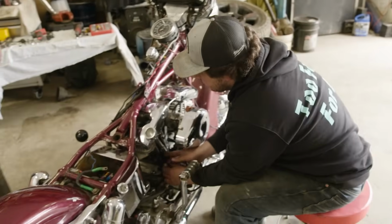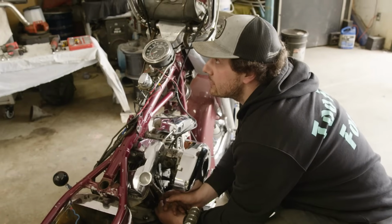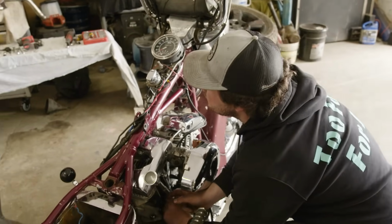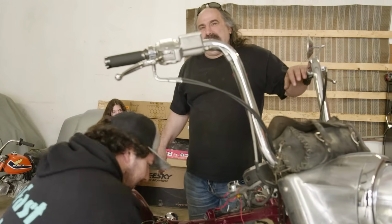Okay, guys, we got this thing all set up now. There's a perfect amount of drag on it. We won't even ask Dad for his opinion because we don't care about it. Make sure that today it's a little bit sloppy. It is a little bit sloppy. Can you feel it, tick, tick, tick, tick, tick, yeah? Yes, barely. Now tell them why you want it sloppy, though. I just told him, you want a little bit more clearance in there because when it gets hot, everything will expand out. And if it gets too hot, so it's nothing to do with my driving? Yeah, your driving sucks. I haven't rode this thing in a whole year. I know, the bike really appreciates that more than you know. You miss me?